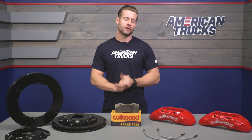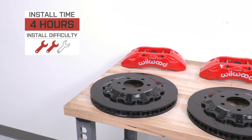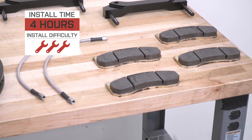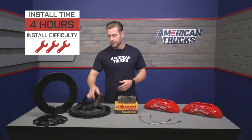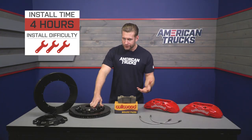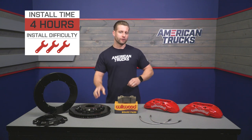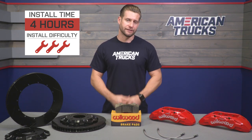If you have a smaller wheel currently on your truck and you don't want to get rid of those but still want to upgrade your braking capabilities, I would recommend checking out an aftermarket rotor and pad combo that utilizes a factory size rotor but with a more aggressive pad — that will be your best bet without having to upgrade your wheels. As for installation, we did kick this up to a full three out of three wrenches on the difficulty meter, not because brakes are tough per se, but because there is some safety wiring involved in order to get your hat mounted and secured to the actual rotor. Safety wiring isn't brain surgery, but it's a little bit tricky if you've never done it, so give yourself a few hours from start to finish.